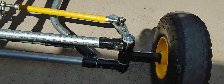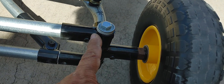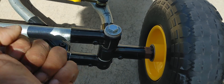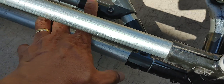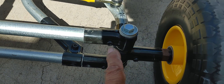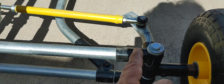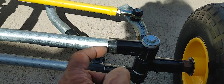These pipes need a bolt right through the tubing here, or the pipes need to be pressed with a die to create a dent on the inside so that when the pipe inserts all the way in it creates a more rigid attachment. That's the way I did this connection right here — and all the horizontals are done that way with a 3D-printed die I created to make these dents. Unfortunately I didn't take the time to do that and I was trying to maintain the same kingpin-to-kingpin distance, so the bars are just inserted here but not fully.